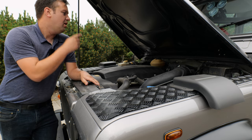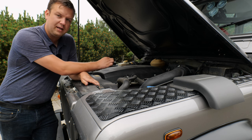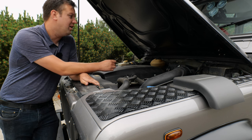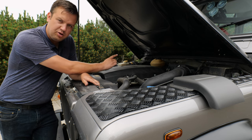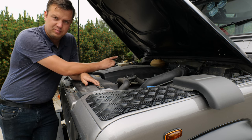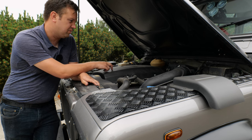We had to fix that one. They're also known to have a problem with their fuel injector wiring harness cracking. The casing around the wires cracks, and then oil pressure seeps up the wiring harness into the ECU in your cab. We know this because this one had it. That's what we replaced. We replaced the ECU when we remapped it, and we also replaced the wiring harness.